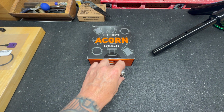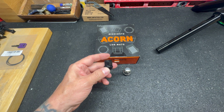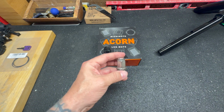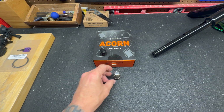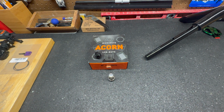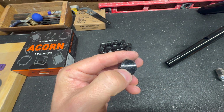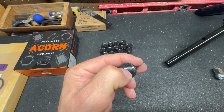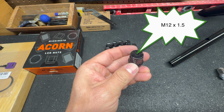This was actually kind of a scary mistake because I had the wheels mounted on the car with the Mishimoto lug nuts and they looked like they were tightened down and were going to work. But when I drove the car, I could hear and feel some thumping from both the front end and the rear end, so I took it back to the tire shop and then they were able to diagnose the issue. Here's a shot of one of the lugs that actually broke through the other side when the tires were initially mounted. So make sure you're not only paying attention to the size of the wheel studs, but also the lug nut depth when you purchase your lugs.